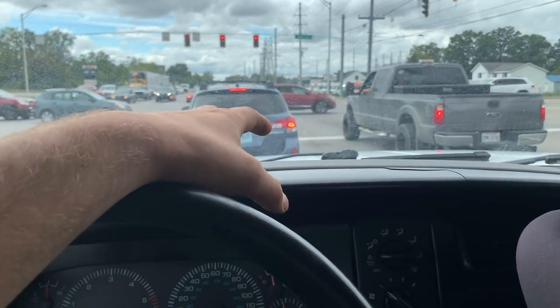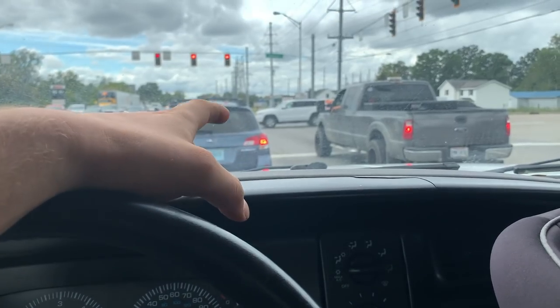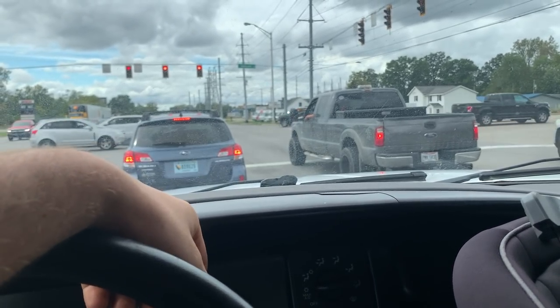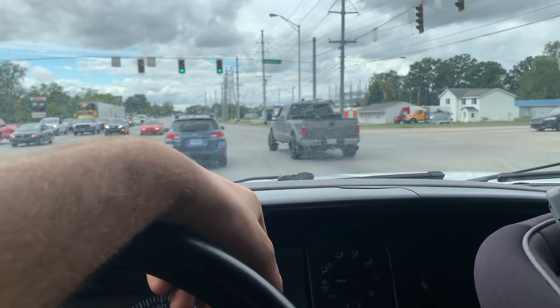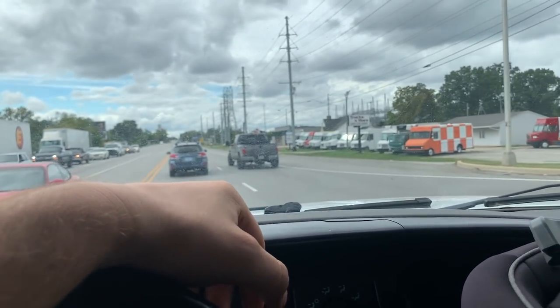Well, fam, we are currently on the road checking for U-bolts, trying to find some U-bolts. I just stopped at AutoZone. They said they don't have any. NAPA said they have an assortment, but likelihood is that they don't have the ones long enough that I need, which are like 14 or 16 inches long. They need to be pretty long for those heavy-duty Dodge pickups with those factory 5-inch rear blocks.